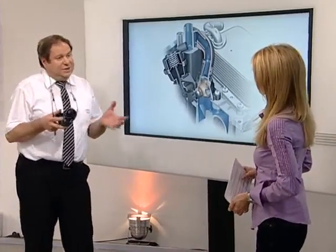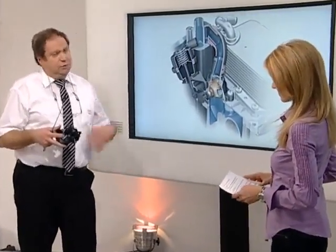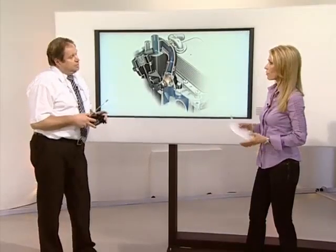We now turn to the oil cooler bypass thermostat. The temperature in the engine block needs to be high but not too high — the oil should have low viscosity so the engine, gearbox unit, crankshaft, and piston rods rotate more easily. A warm, free-moving engine has less internal friction. The oil temperature is maintained up to 103 degrees Celsius; above this the thermostat opens and the oil cooler is integrated in the circuit.